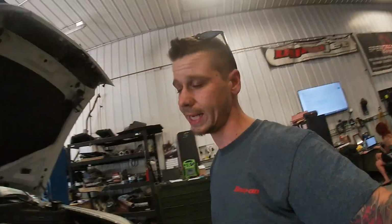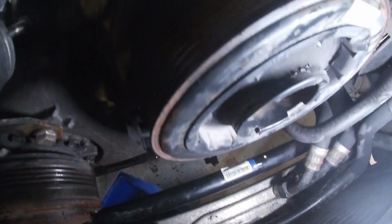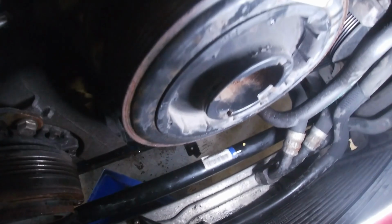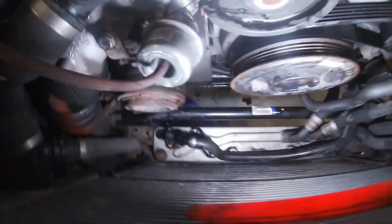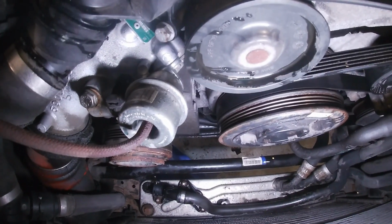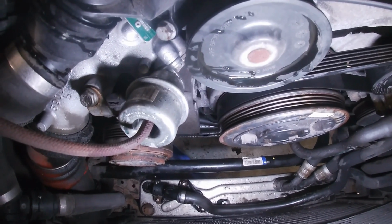Crankshaft dampener part of the scenario. I don't have the proper locking pin kit for the transmission, so I had to do this the old-fashioned way. I just had somebody hang on a pry bar at the flywheel, crack the 4 bolts loose, and I actually cheated on the stretch belt and cut it off because the customer supplied all new belts. I wouldn't have done that going forward.